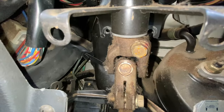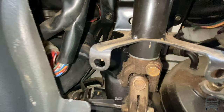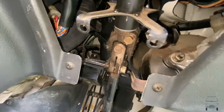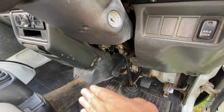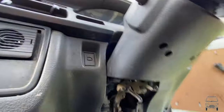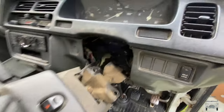I'm going to take both of these out. Now that both are out, there's one here and one here — those two have to come out. Keep a hold on everything because at that point the steering wheel is going to come down. It's also a good idea to have your universal joint lined up even with the seat so it doesn't bind the joint. These upper bolts look different than the lower bolts but are still 12mm. Alright, my last one's out. I'm holding the wheel with my shoulder — I'm just going to lower it down. That's it, so that gets that out of my way.